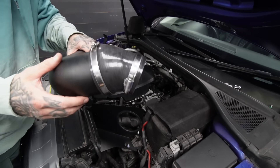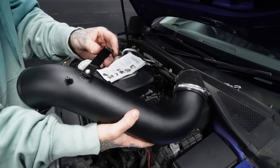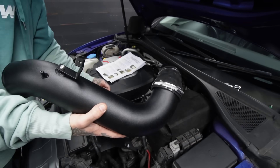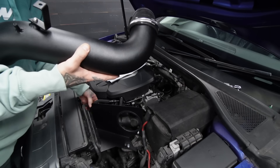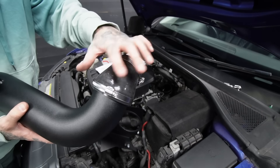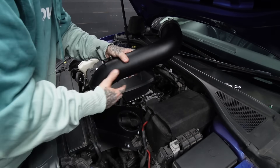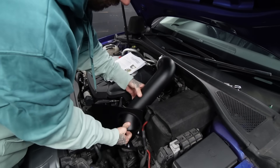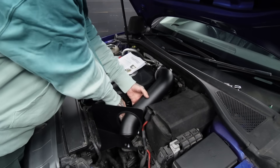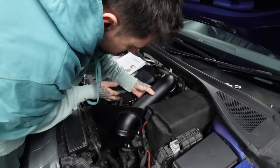Moving on, we've got a bracket which goes between the side of the head and the intake pipe. This section on the intake pipe is for the little hose I removed earlier in the video. I decided to run the jubilee clips giving me access at the top and at the back once it's fully installed. We're going for the install — putting the section through the hole on the heat shield bracket, which allows us to push the back down and into place on the turbo pipe.